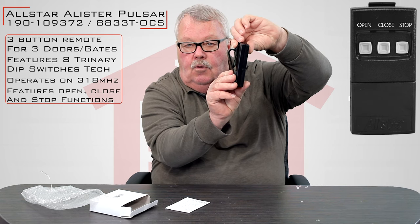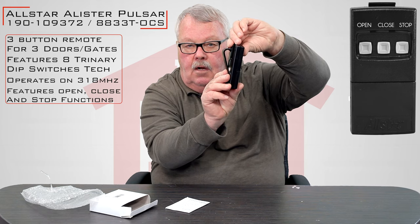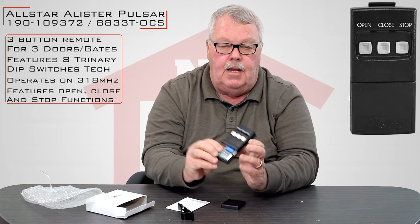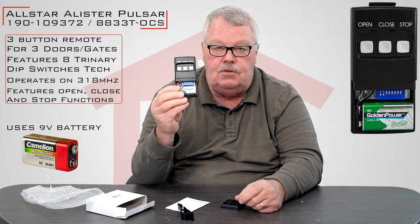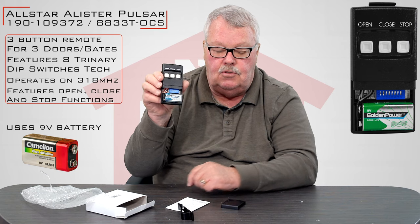You can slide that over the visor of your car to keep it from rolling around and getting you in trouble. There's a little trap door on the front of it — pull it down. If you can see in there, there's a set of dip switches. You're going to have to use those dip switches in the process of setting it up or programming it. It's got a 9-volt battery and it comes with it, so you don't have to buy anything additional.